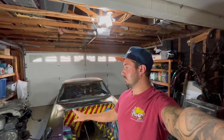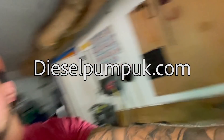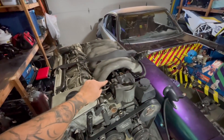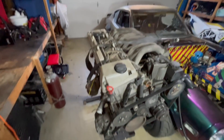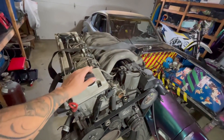A couple of things learned — we need better lighting in here for sure. We got the engine out, this one's all set and ready to go, and it only took a couple hours. It's not very hard to work in here, so if you have a small garage at home you could do this in your driveway if you really wanted to. We're waiting on parts from the UK — big shout-out to Diesel Pump UK. If you're building one of these, they're in my opinion the best place to get all the stuff you need. We're getting everything we need for 500-wheel horsepower from them. We're waiting for that mechanical pump. You don't need to do anything with the injectors on this engine — they're pretty much just check valves. The pump is what dictates how much fuel goes into the engine. Diesels don't have throttle bodies, so it's all air all the time. The other part of the equation is a big turbo — we have a few diesel turbos in the shop, we'll size them up. You don't need to do anything with the internals; these are very stout for our power goals.